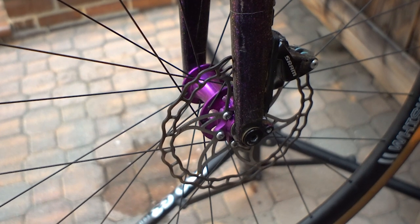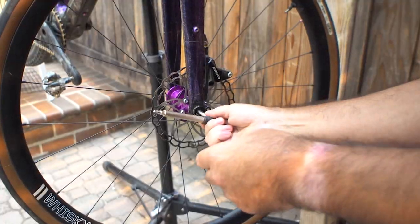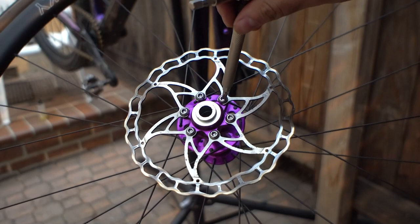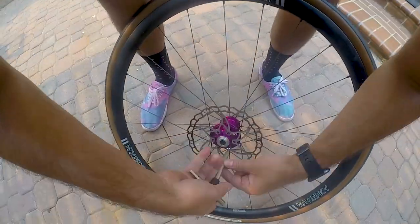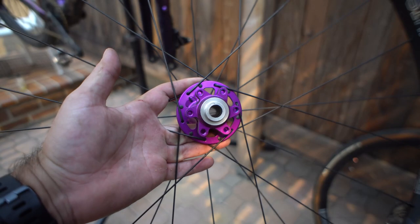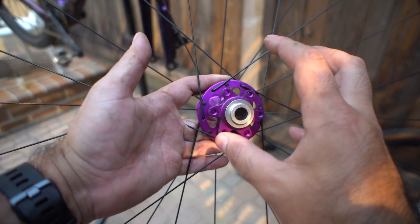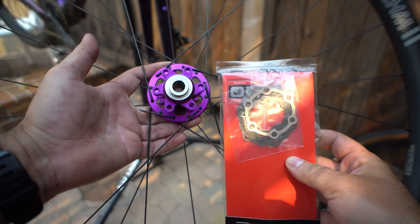It is worth the process even though it's a little lengthy with a six bolt rotor, because once done these wheels will swap beautifully back and forth. Simply remove your wheel, then take your T25 tool — or whatever bolt head you have on your disc rotor — and remove it. The same rules apply if it's center lock. Then clean your surface or re-grease your center lock hub if needed, and then simply add your shims.